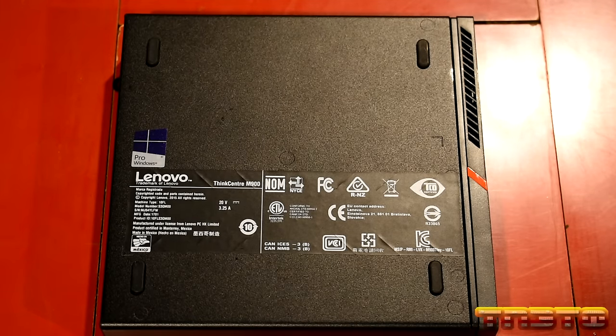Next thing I'm going to check is power options. Unplug it and turn off the screen. We'll set that to 30 minutes. Never. One thing you want to do, never let your computer sleep. You want to be in control of your computer, okay? Then we'll click Advanced Power Settings. So see how it says turn on fast startup, recommended? You want to uncheck that. You don't want fast startup, okay? Show sleep in the power menu? No. Don't want hibernate either.